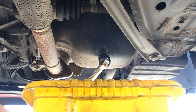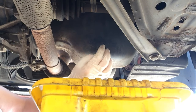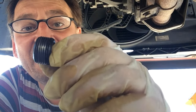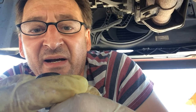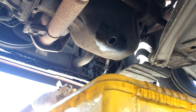I'm going to drain the oil first and then get the filter off. Nice clean sump — it came out just covered in oil, no grit, there was no roughness when I was undoing it, so it's all fine. Some people put little magnets on the sump plug to catch any flakes of metal from engine wear — you don't need to. With all that oil moving around and being pumped through, the chances of picking anything up on there are quite slim. You're far better off just inspecting the filter; that's what the filter's job is. I've just cleaned around there — you don't really need to, nothing's going to fall in.